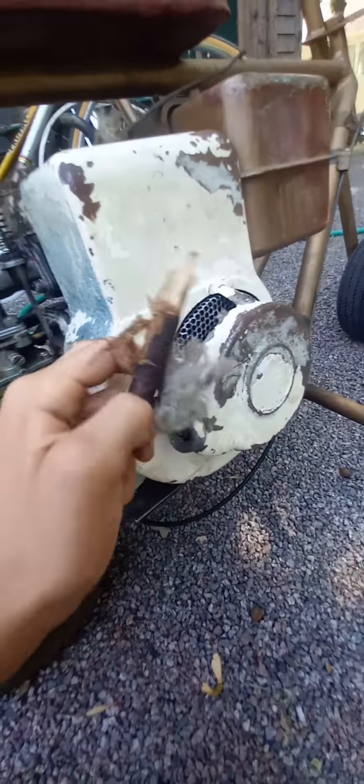This is the makeshift starter — it's literally a very, very old stick. But other than that it runs like a dream. We were super lucky that he had an extra float pin. We had to take this entire carburetor off — it's very oily underneath there. We took it apart, figured out the problem, put it back together. He already had an idea it was probably the float. After that we pulled it twice and it started right up like a dream.